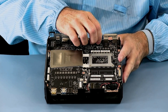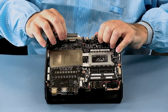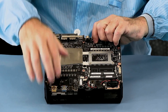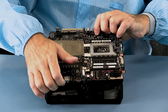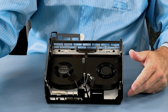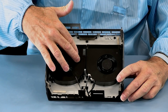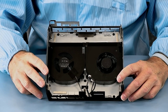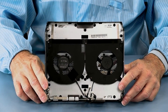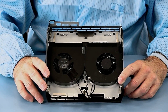At this point the motherboard should be loose — yes. The band cable is out of the way. The motherboard has to come straight up because the heat sink is long; it goes all the way down to the bottom of the chassis. We now have the motherboard out of the way. Taking a quick look at the bottom: we have our left and right blower, and the motherboard is marked for left and right — it matters because one cools the CPU and part of the GPU, and the other cools the GPU. You can see it's easy to blow out the blowers from the bottom and there's no need to take it apart to clean.